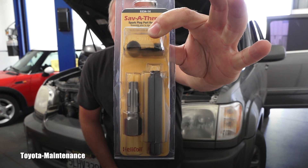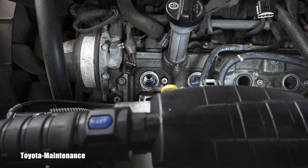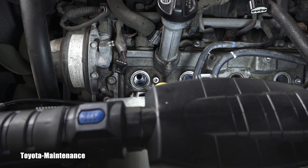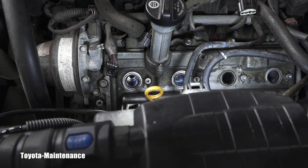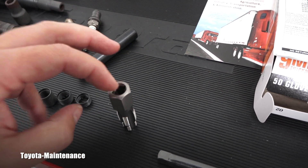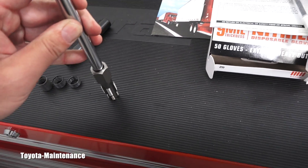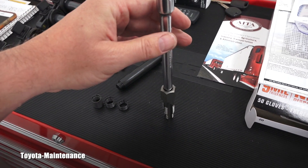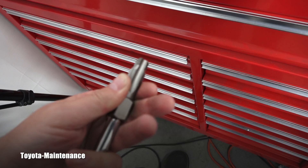This set is actually meant exactly for this repair — it's not some generic repair set, but it's meant for the heads in these cars. If you look inside these spark plug tubes you can see the thread to hold a spark plug is really deep in that spark plug tube, and it brings multiple challenges. Here you can see the reamer itself — this one fortunately has a hole for using an extension, so that's good. But if you go so far in, how do you keep the whole thing perfectly centered and cut that perfect thread?